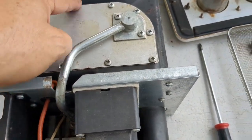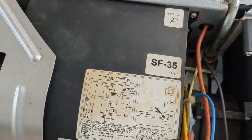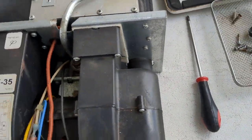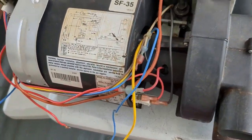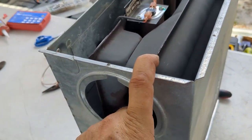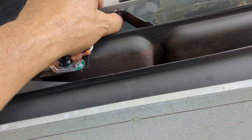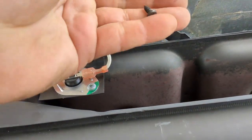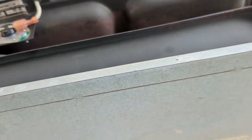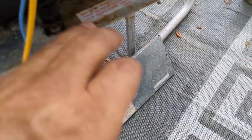Okay, we just put everything back together — screws tied, bolt in the bottom. We're going to put it back on the grill, secure everything, and put it back in. Now, I forgot to mention — this is the back side of the furnace and it looks like it was taken out before; there's a screw missing over here that I'm going to put in. When you take it apart, you must take the back cover and find this screw — there is one on the front and one on the back. I'll show you in a minute. This little one will be the one on the back.